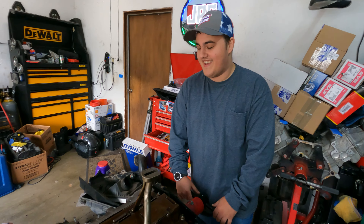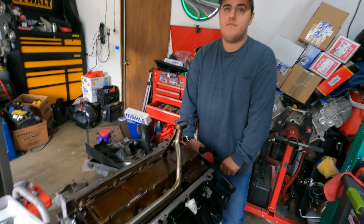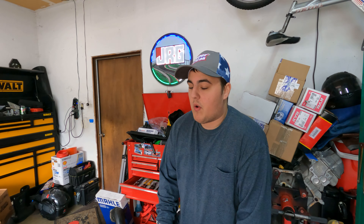So with fewer complications, we had to tear apart the motor. We kind of made that mistake because you can't put a third gen engine in a fourth gen truck or car, because the PCM won't be able to read the cam and crank position and it'll just constantly crank over and nothing will happen. I didn't really do the most research when we went to do this. I was told these are supposed to be like Legos. But apparently people swap fourth gen engines into third gen trucks — they don't swap third gen truck engines into fourth gen trucks. So that's why we had to do all this.